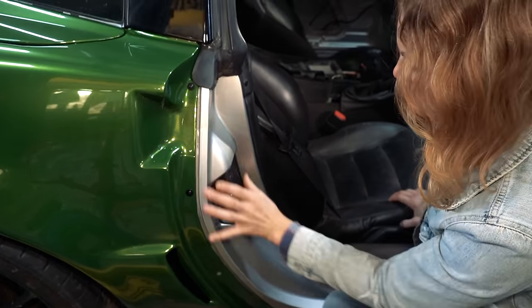Oh, check all the suspension bolts. I'm going to put it on the lift and get it in the air. So check suspension bolts and the fluids. Check transmission fluid, diff fluid. Make sure nothing's loose back there. The oil hasn't been changed that long ago, so we'll probably just roll with it. Put some fresh Peak antifreeze in it after we do the coolant system stuff.